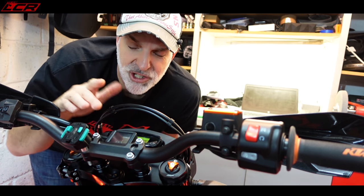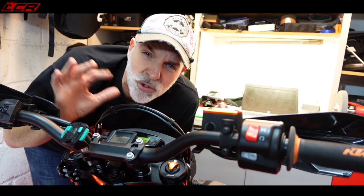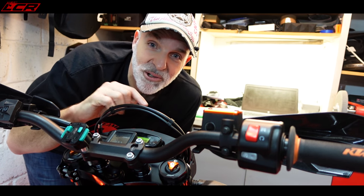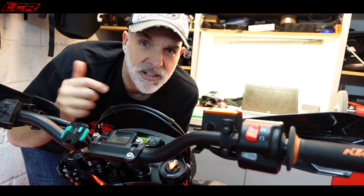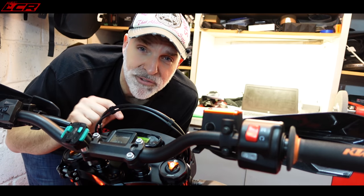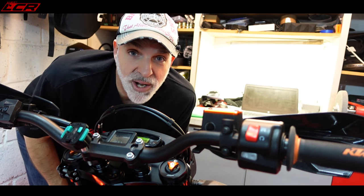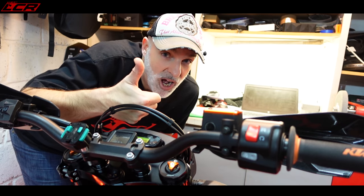What I now need to do is go through and set the shift light revs — you can adjust all that on this, and set when you want an engine temperature light to come on. You need to really run the bike to see how hot it runs normally and then set your maximum temp warning based on that. I think I'm going to ride it and decide what revs I want the shift light set at. But it's brilliant — really happy with that. 120 euros from Barotech, link in the description. I think it's well worth the money — it brings a lot more functionality to the display on this bike.